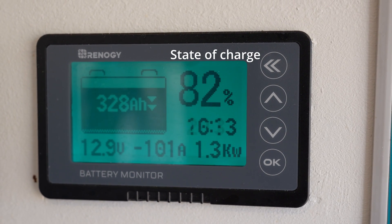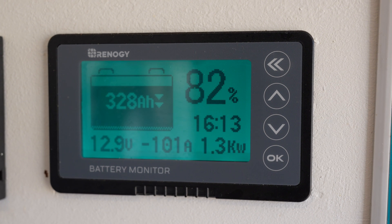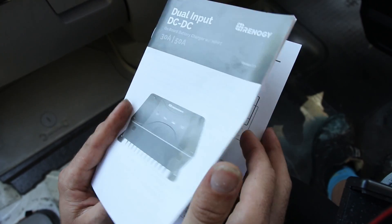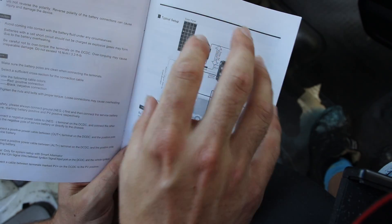The smart shunt and monitor provides really good information such as the state of charge, how many amps we're drawing, how long the battery is going to last on the current draw — so how long until it's flat — or when it's charging, how long until it's fully charged. It's really easy to use and it's a good reference to have visible all the time. The manuals that come with all the products are pretty good and relatively easy to interpret for doing self-installs. The one that was probably the trickiest was the inverter and how you wire in the mains charging side, but generally they tell you wire sizes, fuse sizes, and it's pretty straightforward.